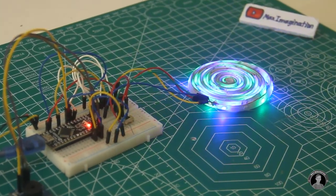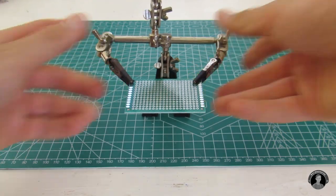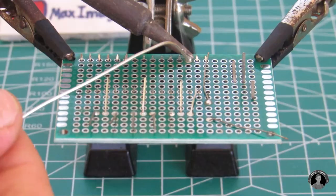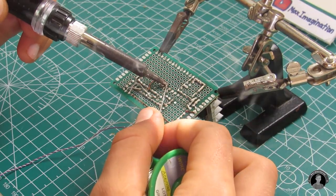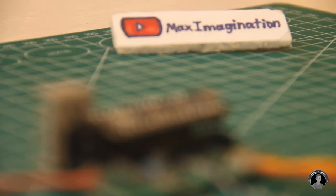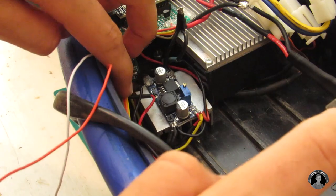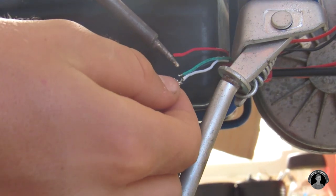Some pure magic. It is time to make this circuit into its final form. Instead of the breadboard I'm using another one of those zero PCB blank boards, additionally with a voltage regulator of a set fixed voltage of 5 volts. Now I'll make the connections for all of the circuit elements. We should be left with power supply wires, a 5 volt wire, two digital pins, and the RGB light wires. After securing the board in place I'll run these four wires to the outside of the scooter for the RGB lights to connect up to.